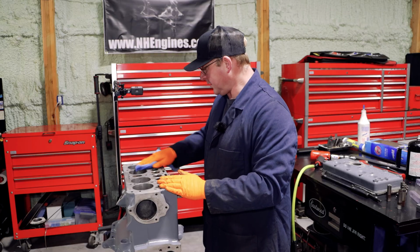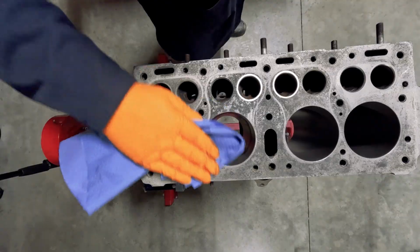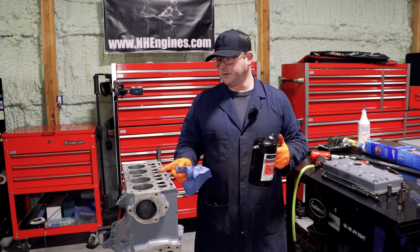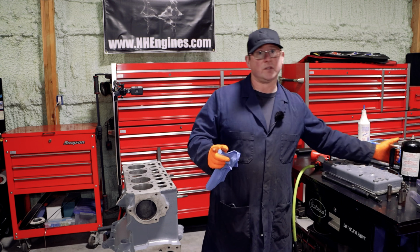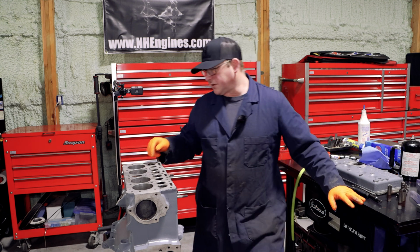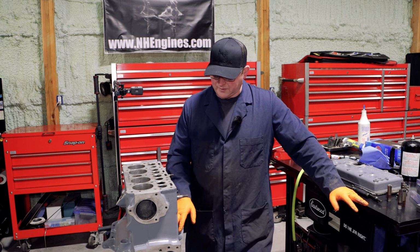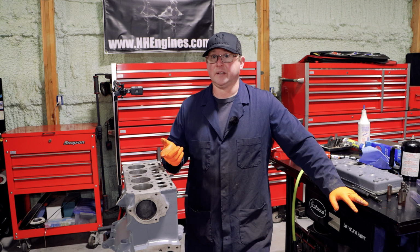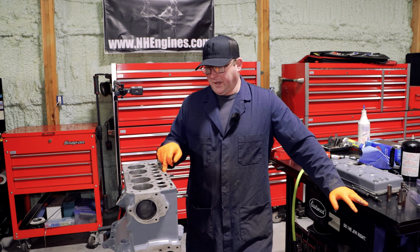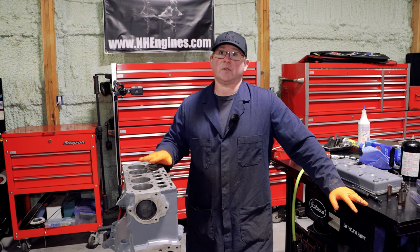And this is a little bit confusing because it's so weird looking from the cleanup. And I'm sure there's a load of you sat here thinking, why is he doing or setting up for machining operations on a block that's already been painted? Wouldn't you paint it afterwards? Well, I've got reasons for doing it this way around. If I paint this as soon as it's come out of the degreasing process, whether that's the laser clean or the hot tank or whatever, if this is prepped and painted, no oil can get back into it from the honing process or any of my machining processes.